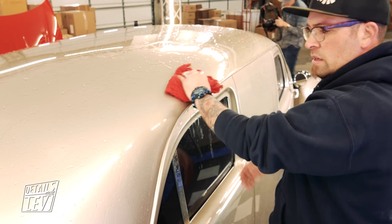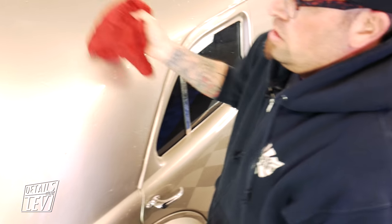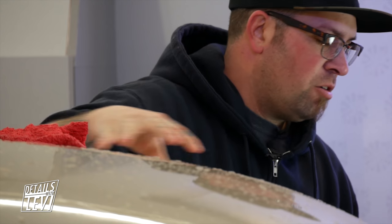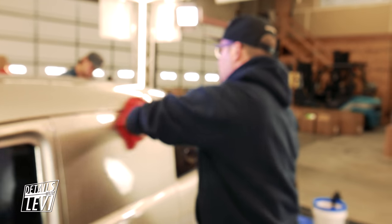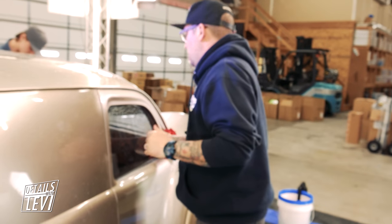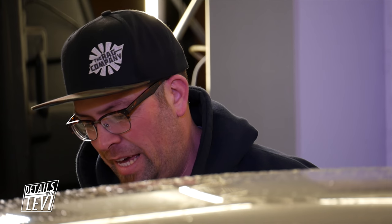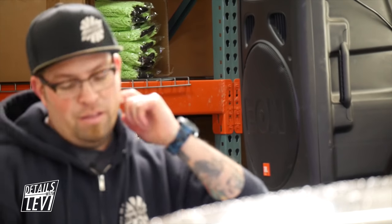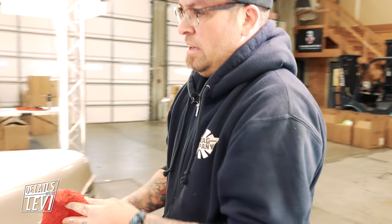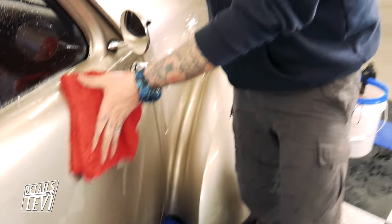The pressure points you leave on the surface are what cause scratching. If you push down and drag across the surface, yes there is a chance of marring, so be very delicate, flip your towel, and work top to bottom — don't take dirty dirt from the bottom and put it back on the roof. That's true whether you're washing with soap and water or doing a waterless wash. I remember one day I thought it'd be good to wash a car with Comet — let's just say my dad was very upset, but I learned how to polish a car that day.